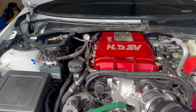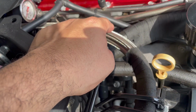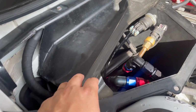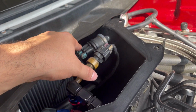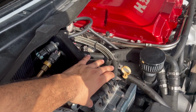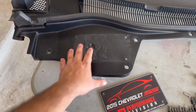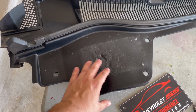How all of this really started was because the fuel lines made contact with the post back over here. These are steel braided lines, and inside is PTFE. So the PTFE melted and the fuel just started coming out and ended up damaging quite a bit of this stuff. Even some of this stuff here is still damaged. Well, it looks burnt, but it's still working. I've tested all of this. I'm not a big fan of how these fuel lines are run, but it gets the job done. And I moved them away from the post back here. So this was the only part I was not able to buy from the dealer, or get my hands on for quite some time.